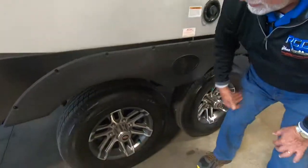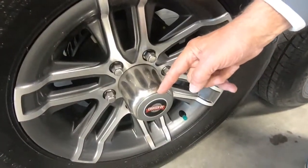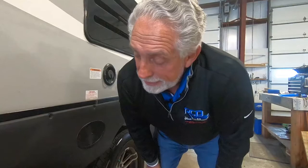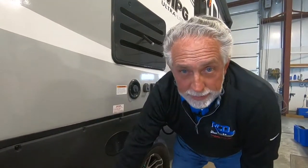You have self-adjusting brakes and easy-lube axles. You take a flat-head screwdriver, pop the ends off at each wheel, and there's a grease zert inside — one to two shots of grease per year is all it takes. I always urge people to pull a wheel at least once or twice a year — either yourself or take it in — just to make sure your wheel bearings are in good shape. Better to check than to see smoke rolling off an axle in your rearview mirror.